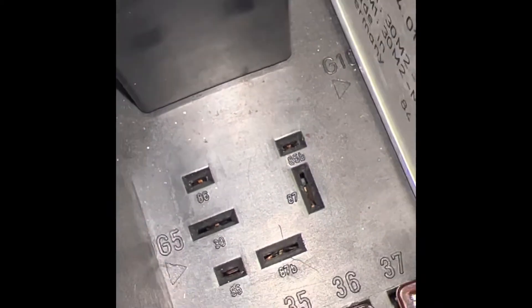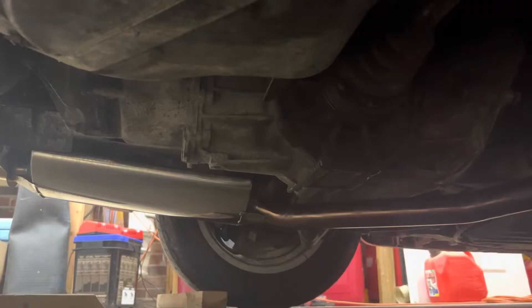Mine was giving a thump in the back, which meant that the motor was pretty much locked up — it was trying, but nothing was coming up. I have the DME relay out and I'm going from 30 to 87B. That's me tapping it — pull it out. It sounds like something's locked back there.